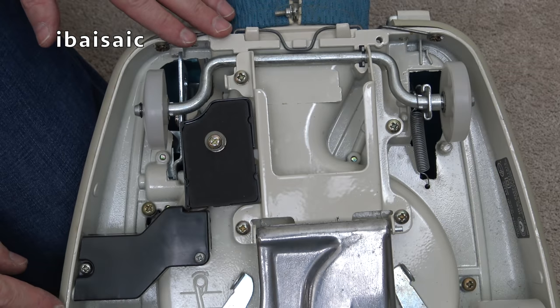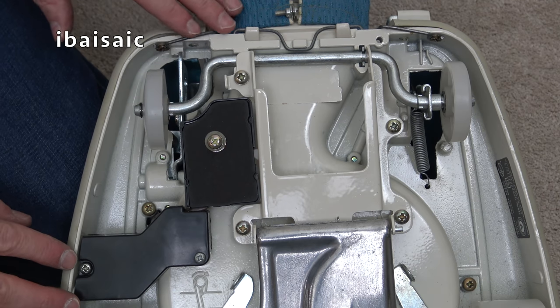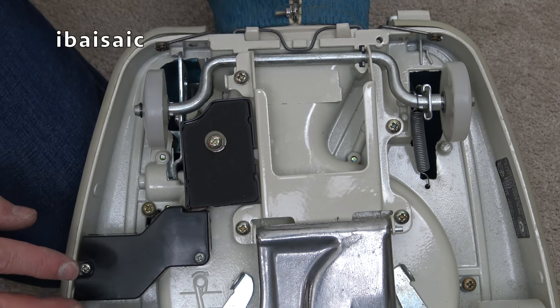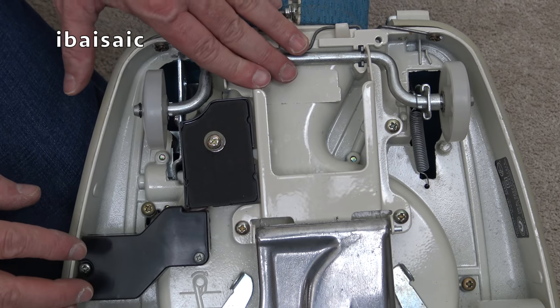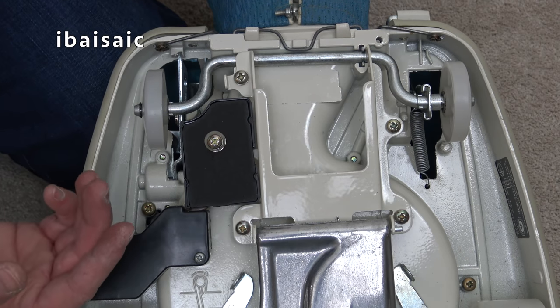Now the Senior has a two-speed motor, so normally it operates at 420 watts. The 20 watts is to make allowances for the bulb, so it's a 400 watt motor. But when you connect the tools, it boosts it up to 650. I always thought it was 600 watts, but it's 650 on this.